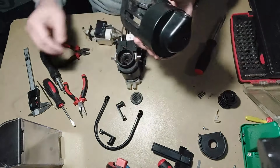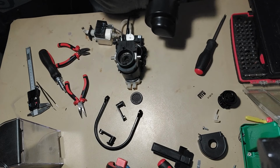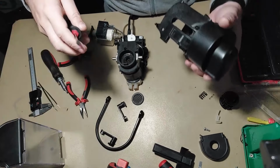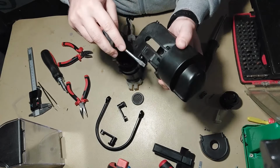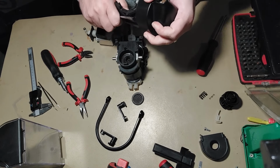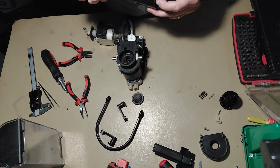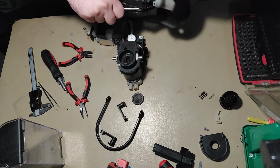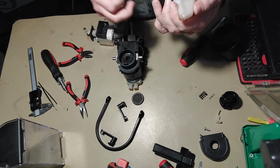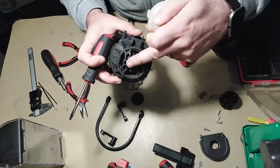Also here and inside of here, you have old coffee that needs to be cleaned. For this, you have to remove this nozzle cover. And then remove here the nozzle. And clean all the old coffee that had remained under here.